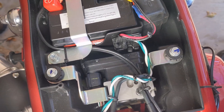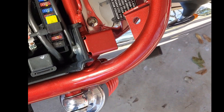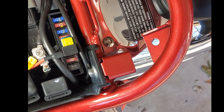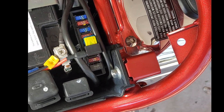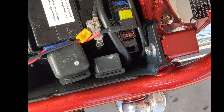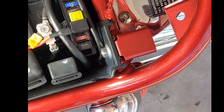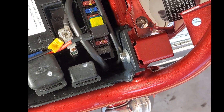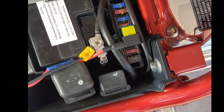The trick is to figure out what voltage reading you need to come up with. First, a fuse coming off of the fuse holder provides power to the red wire. From there, the black wire goes right to the negative post of the battery. The other two wires go to the computer and the original oxygen sensor.